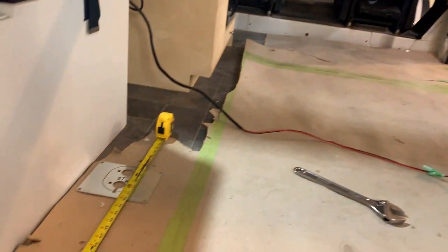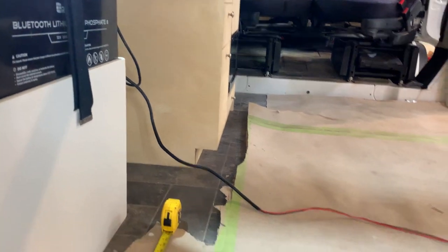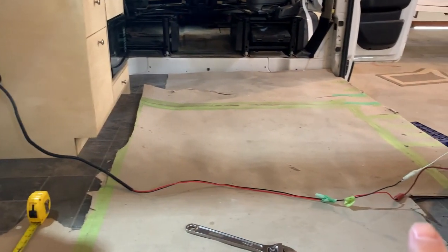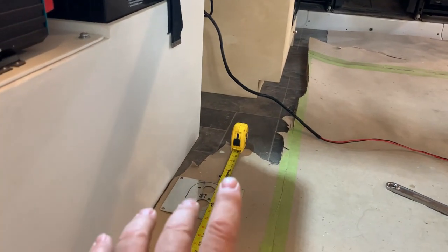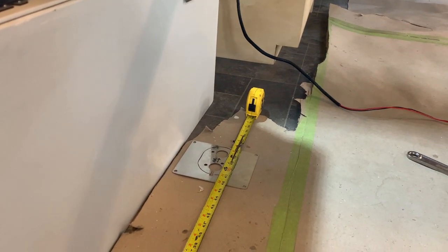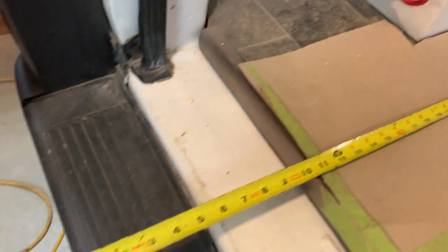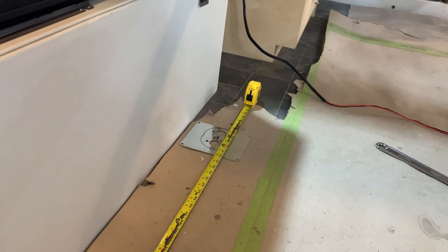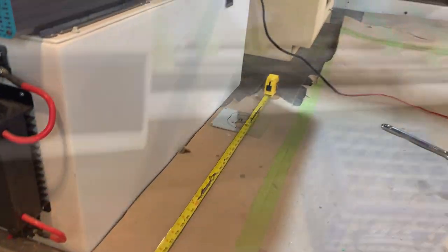Looking in the van here right now, this is where I would like to place the unit in a perfect world. See how that cabinet is sticking out a little bit? That means that when I put the fridge and the next door drawers in here, everything is going to be offset slightly to this side. So this is a potentially perfect location for the furnace. I've placed a tape measure right down to a straight edge, and I'm going to start by measuring this, then crawling underneath and doing the same offset from there to see if it's even a possibility.